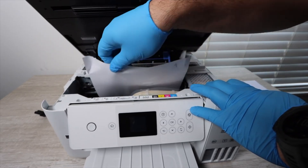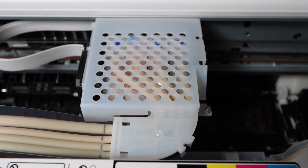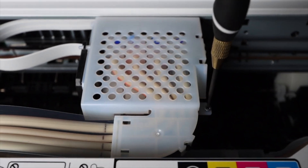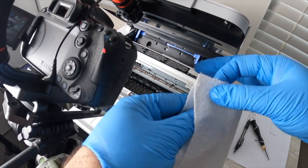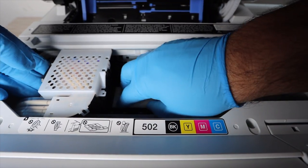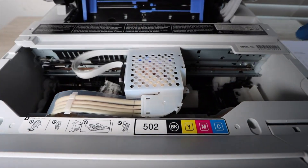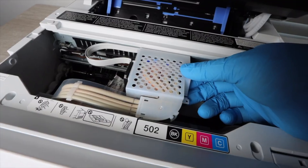Remove that paper so you can fold up a piece of paper towel and place it under the print head. The paper towel will absorb and catch all the dried-up ink and cleaning solution you push through the system. Remove the small Phillips head screw and take off the top piece. Then install the paper towel and move the print head directly over it, completely centered. For every 10 milliliters of solution pushed through, replace the paper towel — so have a roll handy.